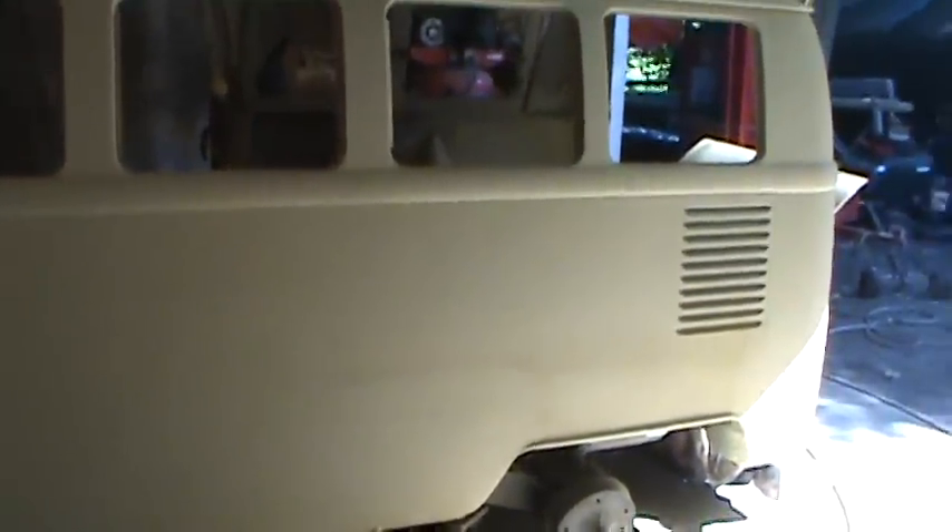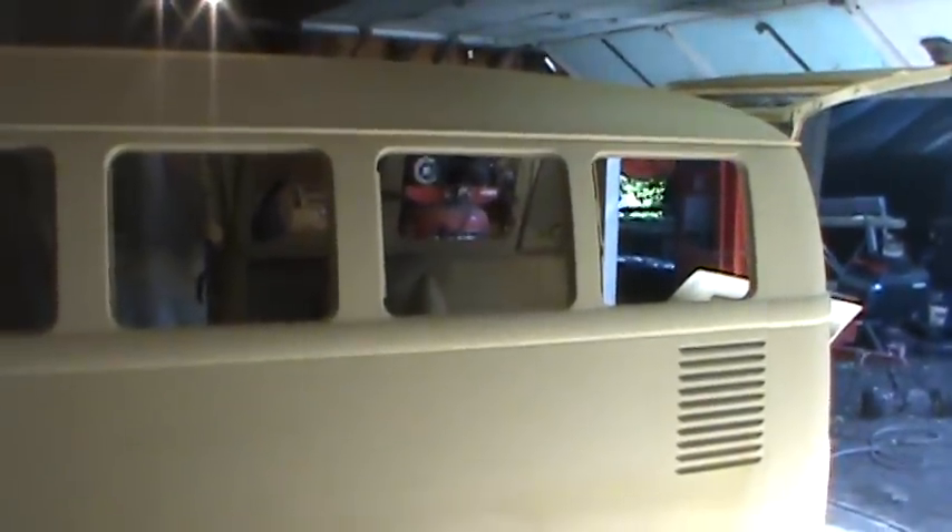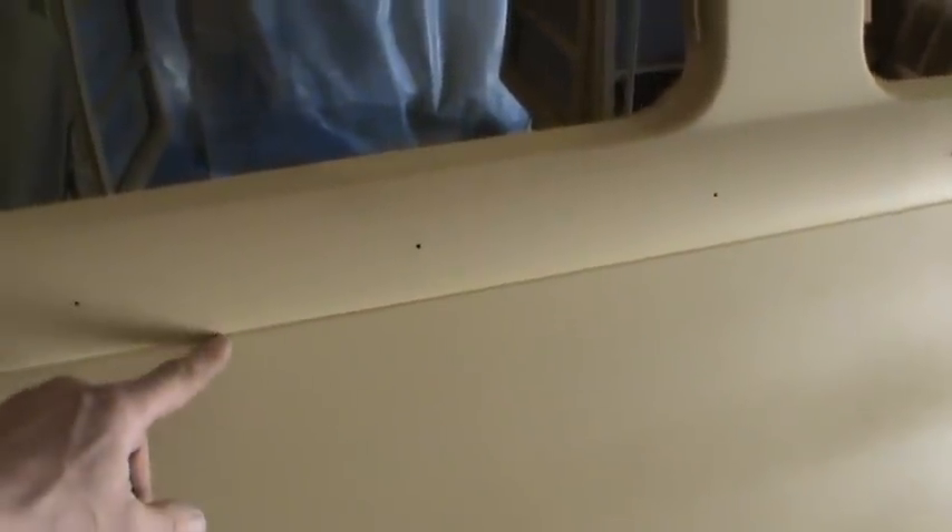I'm psyched. Tomorrow is Saturday — I'm going to plan to let this thing sit 24 hours, which is what I think it needs to off-gas and shrink in as much as it's going to shrink. Then wet sand the whole thing with 400, tack it off, and do the body all in white — all the jams, the dash, the back spacing, around all the doors, the engine compartment. Then it has a blood red color that goes from this line down. My thinking is I'm not even going to mask it — I'm just going to shoot the white, let it overhang a couple of inches, and then mask off the red and shoot down. If that's wrong, somebody give me a heads up.